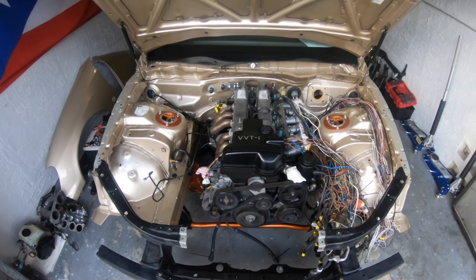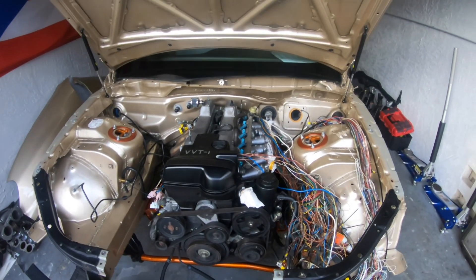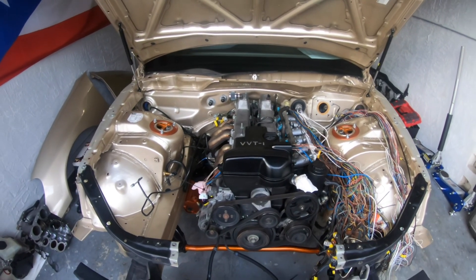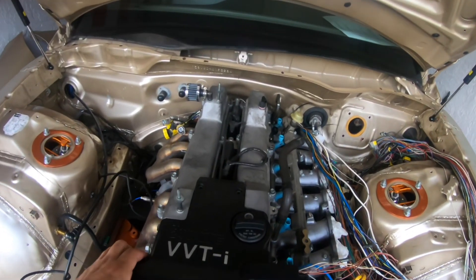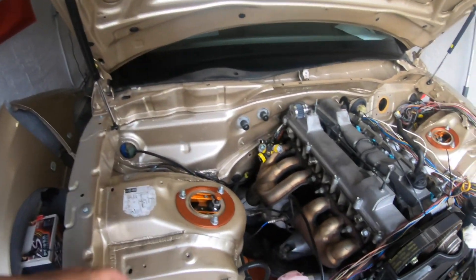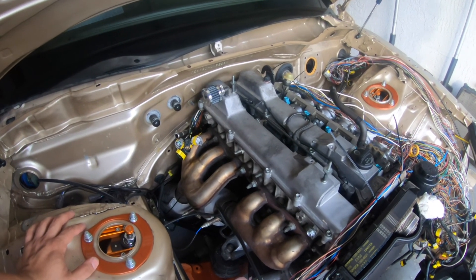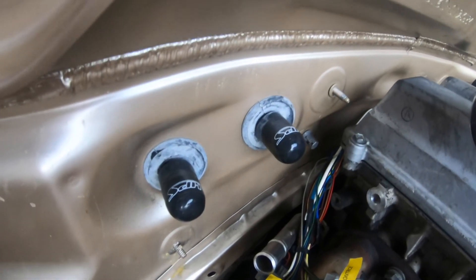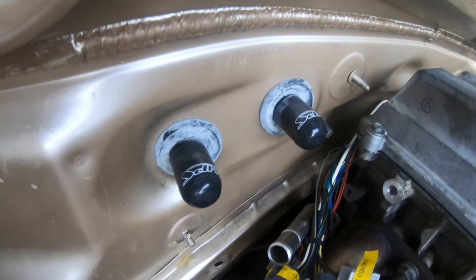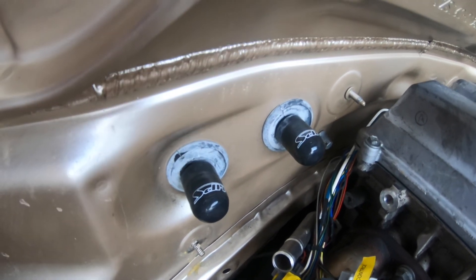Here's an overview of how it looks as of right now. I'll start with the passenger side and explain what's going on and what's to come for the next video. Starting with the passenger side — while I've been working on the wiring, I've also been working on eliminating some of the coolant lines. I've plugged up the heater core using HPS cooling caps — these are 5/8 inch, 16 millimeter caps for those who want to bypass the heater core.